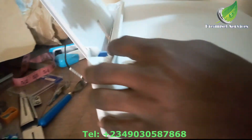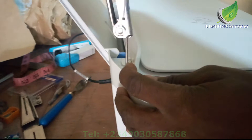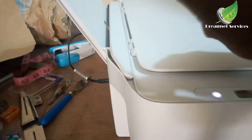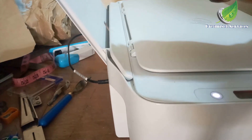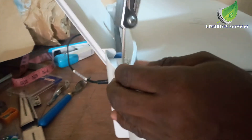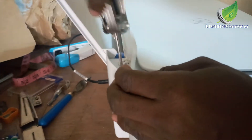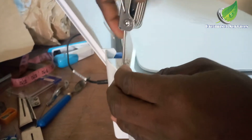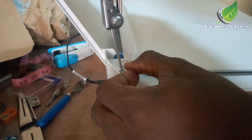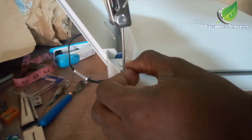Once you bring it out you're going to clean it up. If you clean the scanner cables — that is the flex — and the error still continues, you just have to change the scanner itself, the scanner head, which is the part that moves when you want to make a copy or scan anything at all. I'll show you how to do that now.